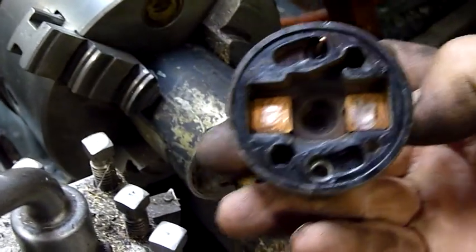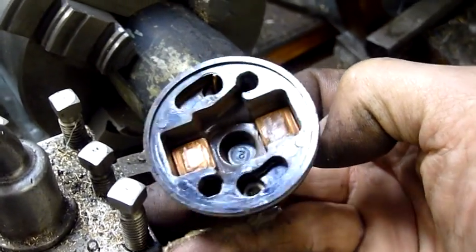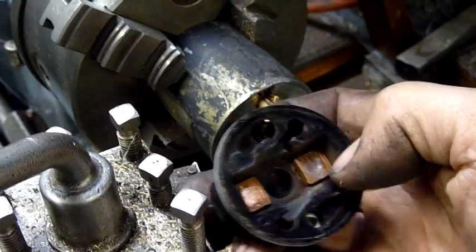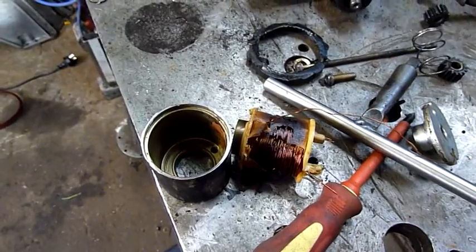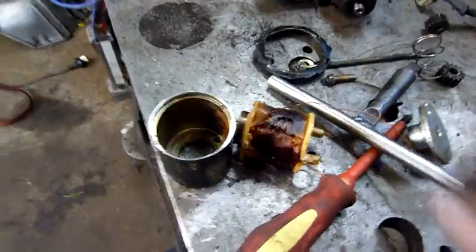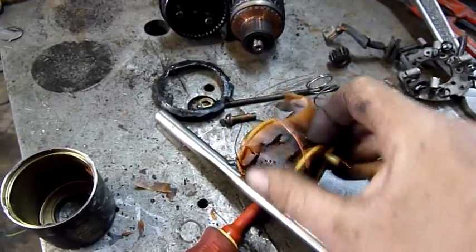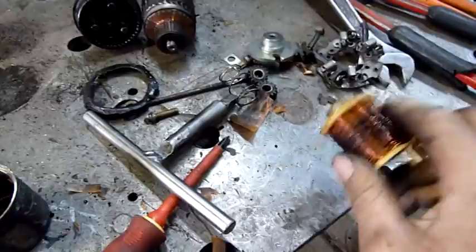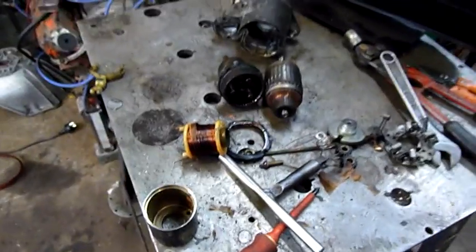Both the solenoid contacts and the starter itself finally gave up all at once by the looks of it. Those contacts have definitely exchanged some metal — that one's built up, that one's pitted. Being DC it's kind of understandable — direct current only goes one way. I know some of you wanted to see inside the coil, and with pretty good reason, because it's gotten very hot — that insulating paper is just almost ash. It got very very hot. It's dead now. Thanks for watching.